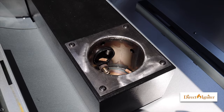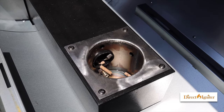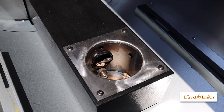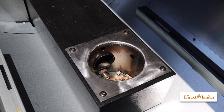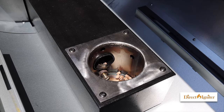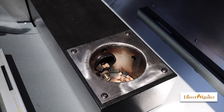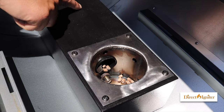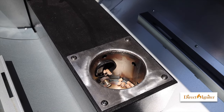Turning the barbecue back on will restart the igniter. That igniter is only on for five minutes, and it takes the pellets three to four minutes just to get to the igniter. So your first time using a pellet stove — or anytime you run it out of pellets — you're going to want to use this method to prime the barbecue. By 'prime,' all we're doing is getting the pellets to fill up the auger tube all the way, so that when we start the barbecue it gets pellets right away.